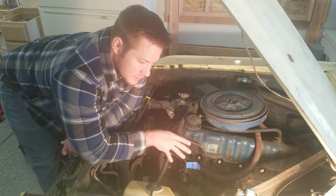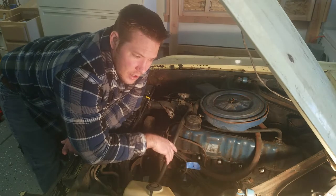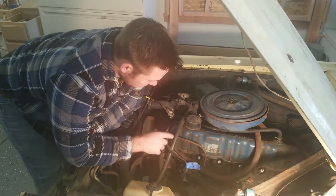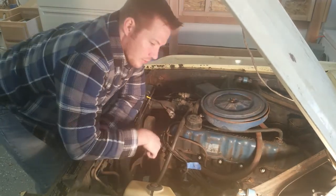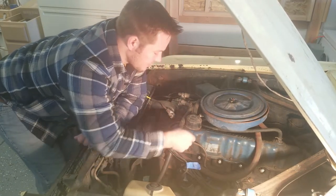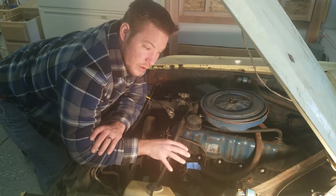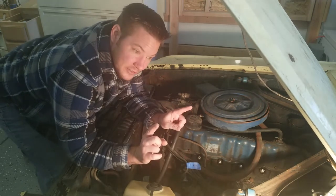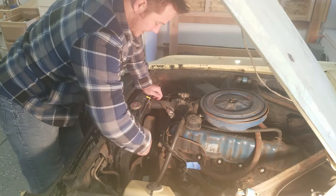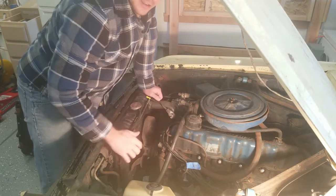Some people like their own specific types of penetrating oils or their own mixtures — I knew a guy who would use a 50-50 mix of transmission fluid and WD-40. I tried getting it to turn over by putting a socket on the main crank bolt, but it doesn't have much of a moment arm. When you're dealing with the amount of friction across the surface area of all the cylinders, it can be quite a lot to break that friction where they've seized up. The little handle doesn't have enough moment arm to break it, so I'm going to pull off the fan to get my breaker bar down in there and get a much bigger moment arm.